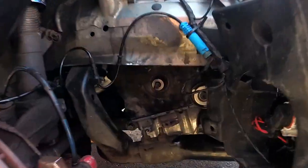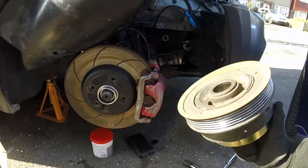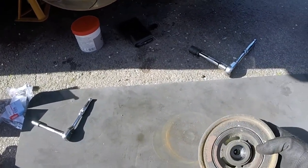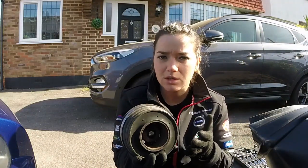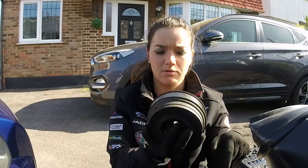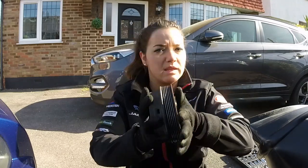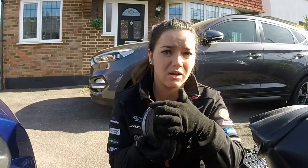And there you have it. So my thrust pin is still in there — I'll just have to screw that back out in a minute. And this is the crankshaft pulley that's now come off of the car. It's actually not too bad to be honest. So that is my old crankshaft pulley off — it's actually not in too bad condition. What happens normally is this outer ring is made of rubber, and over time that rubber tends to crack and then separate the outer ribbed ring from the inner part, and it will just totally spin independently. So yeah, it's actually in really good condition — the rubber itself is okay, there's nothing wrong with that.